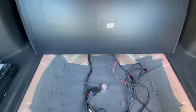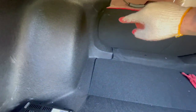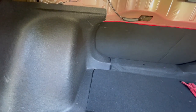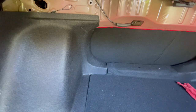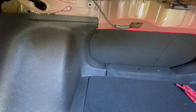So yeah. So guys, you see how I had the wires that were under the seat? See how I explained to you guys of the wire going through the side of the car, positive and negative, for both harnesses, because I have two harnesses there. There's one harness that goes for the second compressor. For those who get the Airlift 3P with the second compressor, it's a separate harness that the compressor comes with. So there's one that gets connected with the main harness. I will show you on a diagram right now.